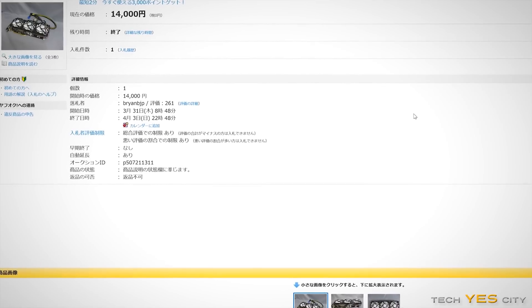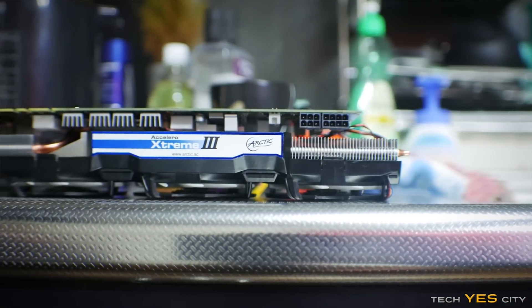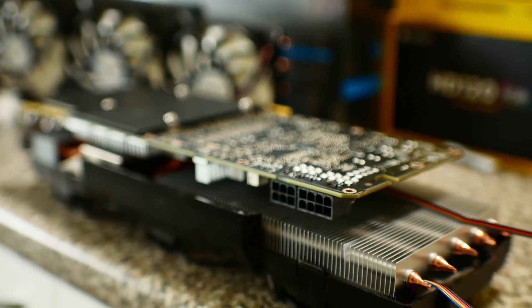All these coolers here — Arctic don't even know I'm making these videos, I've just bought all of them myself. The first time I came across one of these coolers was in Japan when I bought a GTX 780 which was like a junk cooler, but it still worked once I cleaned it all up — it had one of these included. I was just blown away by the performance of these coolers — they're simply phenomenal. Ultimately, the Accelero is just a really cool mod to do, though keep in mind you will void your warranty, so I don't recommend doing it unless you've got a bit of experience. If you want to gain experience, go into the used graphics card market, pick up something really cheap, get some practice like I've done in the past, and then you'll be on your way to much better temperatures and better overclocks.